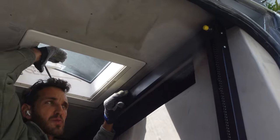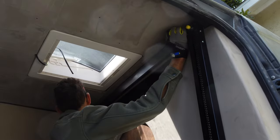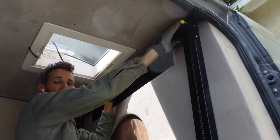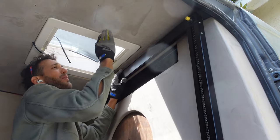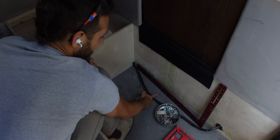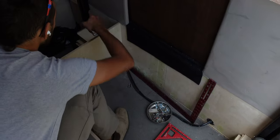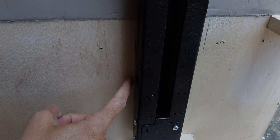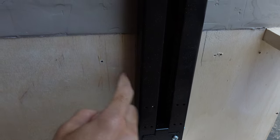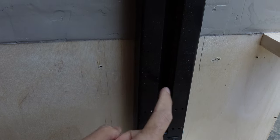You also want to mount the Happy Jack as high as possible so that when it's in the uppermost position you'll have as much headroom as possible — really trying to get it as high as you can before hitting the ceiling. Some people even cut little slits in the ceiling so those top notches go up into the ceiling itself. What we did is measure our exact center line of the van and from there measured exactly two feet to each side, so the track is exactly centered to the van's center line.